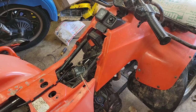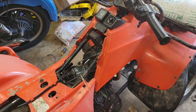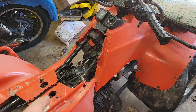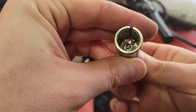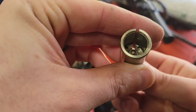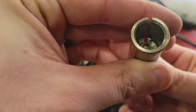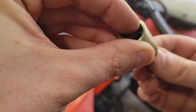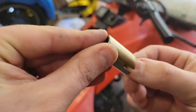But this carburetor, out of the box, it works. I don't know how it works under load yet, but it works, and it bolts right up as we've seen here. You go in there and just move that up another spot. It can be a bit of a pain to do, unless, oh wait, hold on, no, it's not. Push this up, and that's your little throttle retention thing, and that's going to go flying everywhere, and you move that clip.